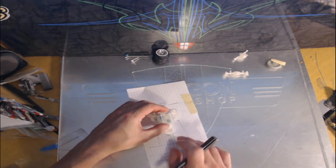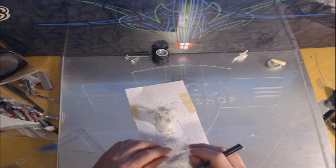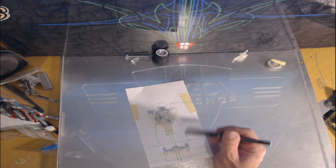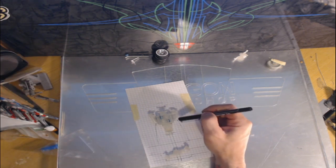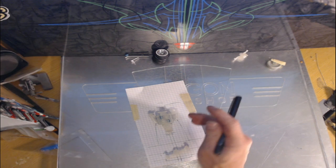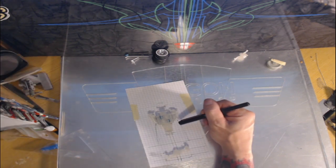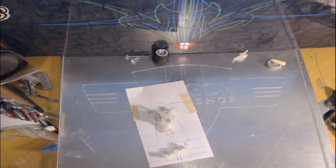So now we know where the motor's got to sit, where the rear end sits, where the back is. So that means now we know where our frame is going to start being built and laid out. With this motor being back so far and trying to clear the exhaust and everything, we've got to build the back half first and get that ride height up to where we need so we can start building the arc, you know, that kind of bends up for the front suspension on a build like this.